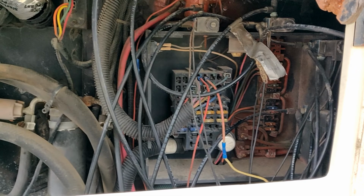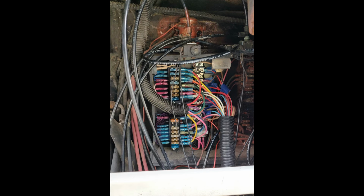The last step was just to install the panel in the RV. Here's the old panel. It was compact and fit pretty well in the space. The new one is larger, and there's still wires going everywhere, but you can kind of tell what everything does. The conduit on the left contains wires that feed up to the driver's control panel. The conduit on the right contains wires that feed to elsewhere on the RV.